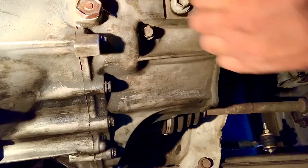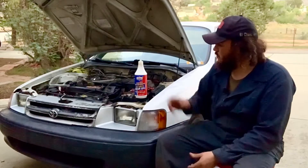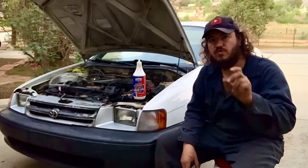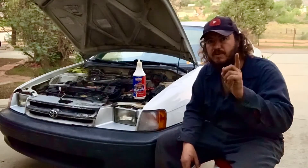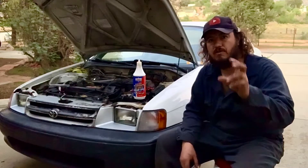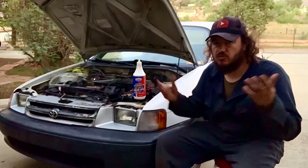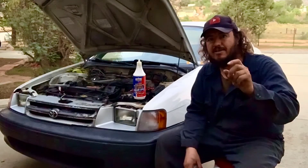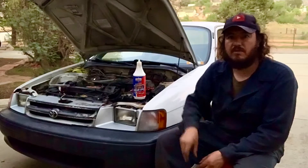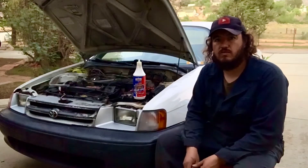And that's how you replace or change the oil in the manual transmission of a '91 to '94 Toyota Tercel. We used just under three quarts. The most important points: always remove the fill-up point before the drain point so you know you can refill; use the hose-from-top method if there's no space for the container; and the only level indicator is oil coming out of the fill-up point. If you haven't subscribed to our channel, please do, give us a thumbs up, share it, and we'll see you soon on El Chano Jose.